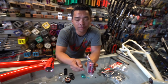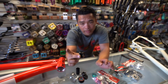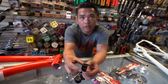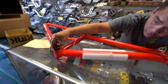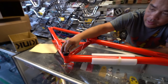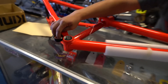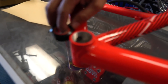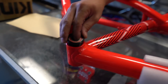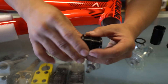What does that mean? On a traditional European inboard bottom bracket, the bearing sits inside where the thread is. When you screw it in, the bearing is going to sit inside the frame. Don't forget there is a left side and a right side. Here's a little secret: anything with a little marking or line always means left.